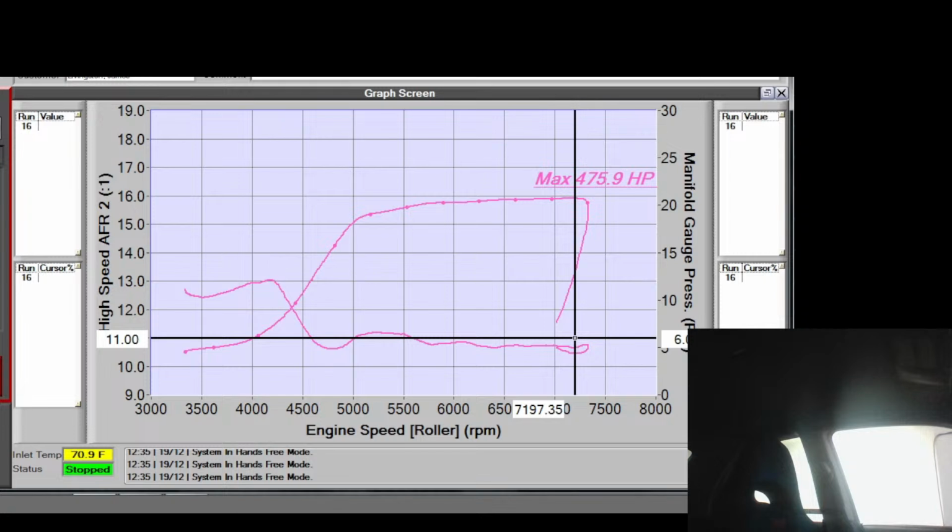So when they're trying to increase the capacity of a battery, it's a lot like building an engine, right? You gotta have the right bearing clearance for the flow. You gotta have enough oil through the bearing to cool it, that kind of stuff. Well, when they're trying to get the reactivity between plates to be high, you gotta fit them closer together. You gotta do certain things with materials, all that kind of stuff. The problem with that is as you tighten those things up, localized heat goes up, and if you experience excessive heating to a point and something starts to deform a little bit, like a plate warps or whatever, now you've got a short internally. So it's just a matter of getting things tighter to get the higher output for the weight, because batteries are shit anyways. Yeah, terrible.